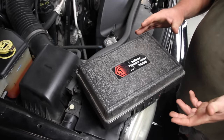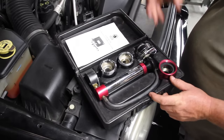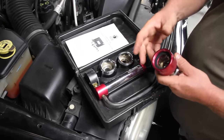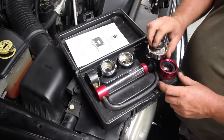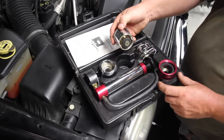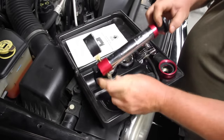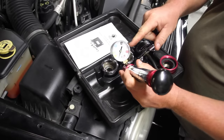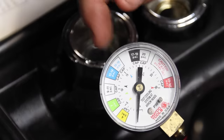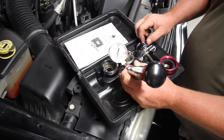There are several different types of pressure testers — this is just one of many on the market. This kit includes a screw adapter for when your radiator cap screws onto a pressure tank, a traditional American-style radiator cap adapter, and two import adapters fitting vehicles like Toyota and Honda. We put this on the radiator, pump it up with the hand pump, and watch the gauge. Your average radiator cap only reaches about 16 pounds, so we'll go up to 15 to 16 PSI — that's where this car is more than likely losing coolant.